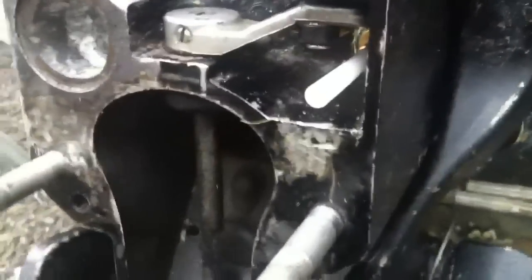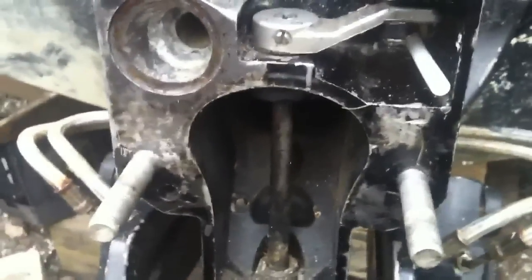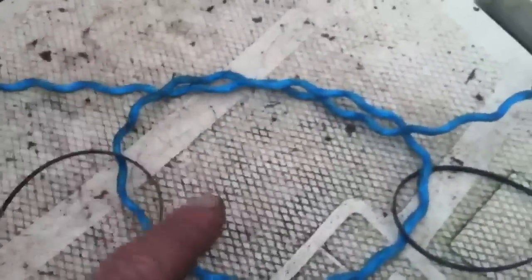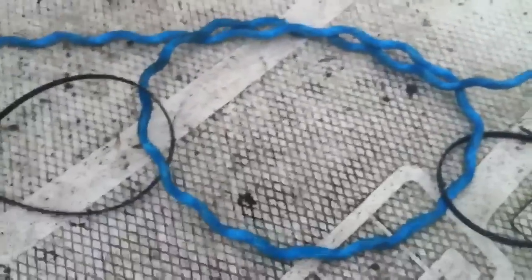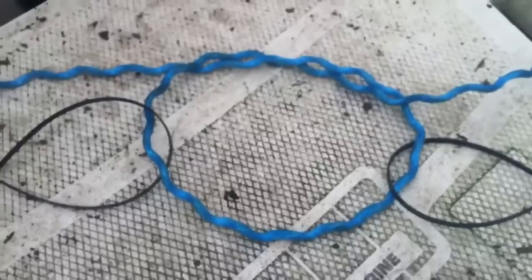Hinge pins can now go in, then I can tilt it up and connect the exhaust bellows to the bottom. There's another trick I've been reading about but I haven't got a bellows expander tool - I think I'll be able to work that out. This is what I'm going to put on the exhaust bellows so I can pull it back towards the bell housing. I'm going to tie the rope around about the third fold in, and use these one on each side which I can pull back on to pull the bellows towards the bell housing and put it into position. Don't forget to put on your clip before you pull it up to the bell housing.